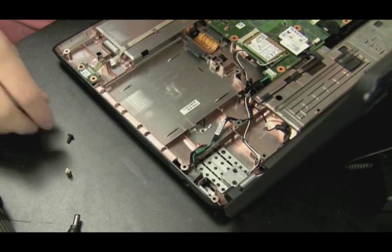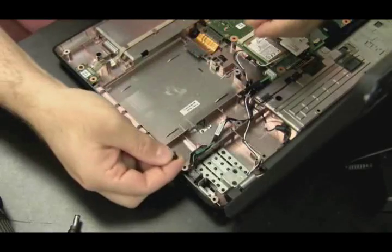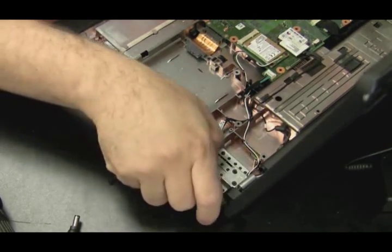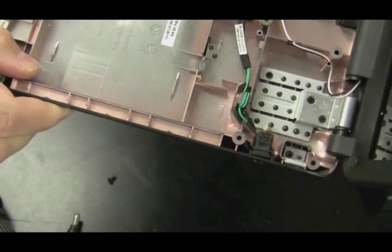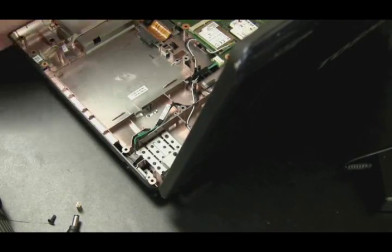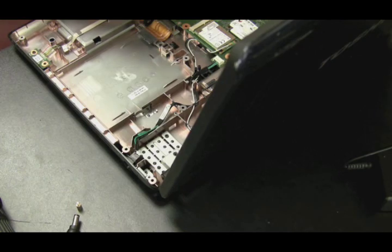Here's the solution I came up with: we're going to use a black screw which is going to screw into the bottom of the laptop through a hole and attach to a standoff that you would use on a motherboard. That standoff is going to be a post that holds the jack into place — right up against the back of the jack. I'll drill a hole directly under where that standoff is, screw the black screw through the bottom of the laptop into the standoff, and it's not going to go anywhere. I'm using a black screw for aesthetic reasons so it doesn't stand out on the underside of the laptop.